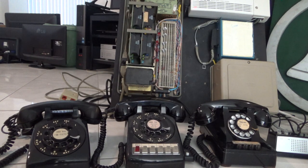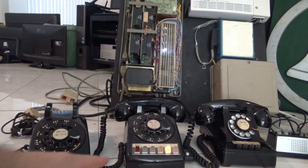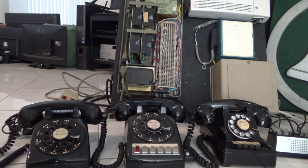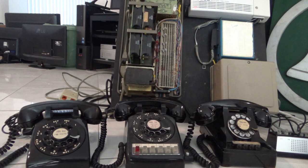Starting with the 502 Western Electric — a 500 set with a lead control. A lead control allows the functionality of the 1A2 key system. When you go off hook, it lights up line four. That phone is wired to line four of the KSU, so going off hook illuminates the fourth line position on the phone next to it. As you can see, line four is lit up. I'm going to hang up and it will extinguish — and it's in idle now.